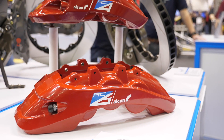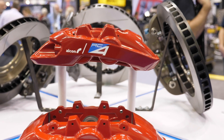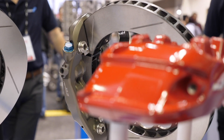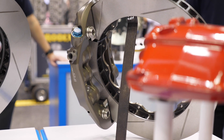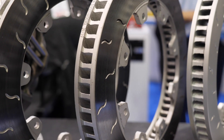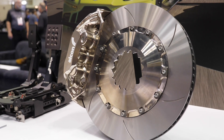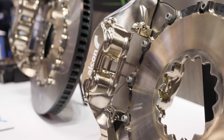The problems are really in the heat capacity of the system. There's not enough mass in a stock rotor to handle multiple high energy braking events. The friction material itself is designed to be quiet and to work well at low temperatures, just around town, and generally they don't hold up to the type of abuse you'd put on a racetrack. So basically the disc, the rotor cannot get rid of the heat fast enough. It's getting heat put into it faster than it can reject that heat. Plus the calipers too are not designed for the high temperatures either.